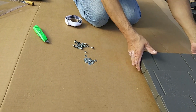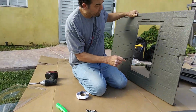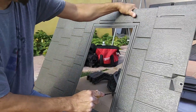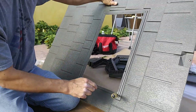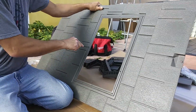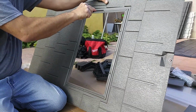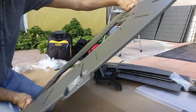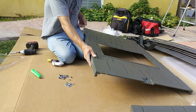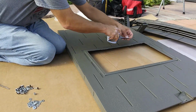In addition to that, the first thing you want to do is open these holes. There's a lot of holes that go all the way around where the window is going to go. As you see here, I take this screwdriver, the right small size, and I do the circular motion, very quickly. I'm making these holes, popping them through, because there's plastic in every one, so I'm poking it through and giving it a couple of swings around so it's a nice open channel, because in a few minutes you're going to put screws through there that are going to pass through the window and the weather stripping and through that hole and out to the other side. So you want it to have no obstructions holding it up.